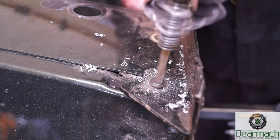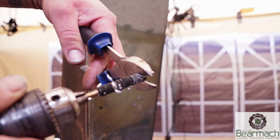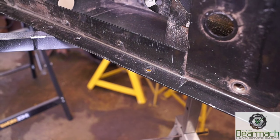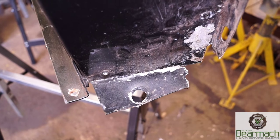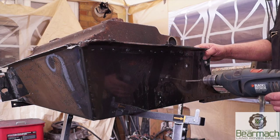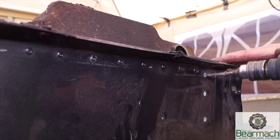I'm using a 5mm drill to cleanly drill out the rivet. With my set of drills I have a 4.5mm or 5mm which is sufficient — it's just the right size. And of course you'll be needing a set of side cutters so you can remove the rivet heads that stack up on the drill. You have sets of rivets that hold in the under seat boxes — on the top where your backside sits under the seat, on the side of the seat box, along the back and along the bottom edge, and at the front. With a drill it's just a matter of drilling these out — it doesn't take very long at all. The bonus is that you can then fix it back onto the seat box assembly once they've been repaired, painted, or whatever you have to do with them.